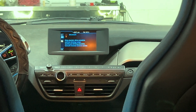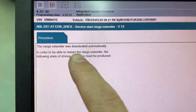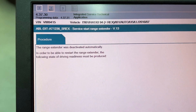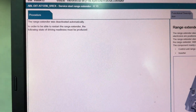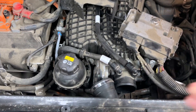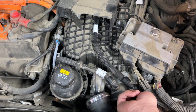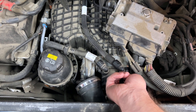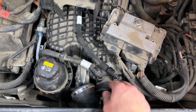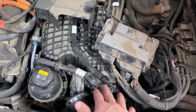It says engine drivetrain malfunction. Anytime that's on, the engine will not run because it doesn't know what's going on. It has a description saying the test was aborted — it doesn't really give you much to go off of. I ran the test again and just out of curiosity, I put my finger in the throttle valve — the throttle plate is open at rest, and I don't think that's normal. So I'm going to run a test plan just for the throttle valve to see if I can actuate it and see what it's doing.